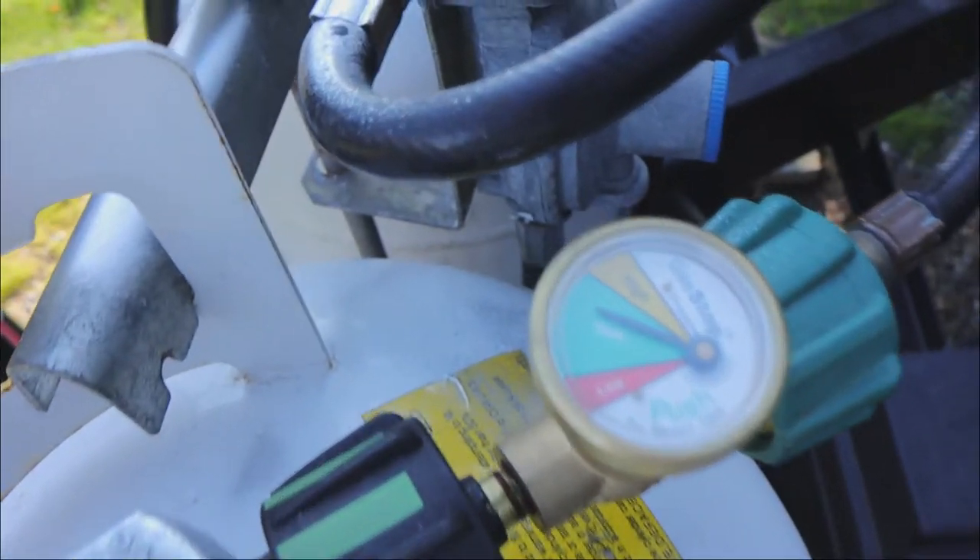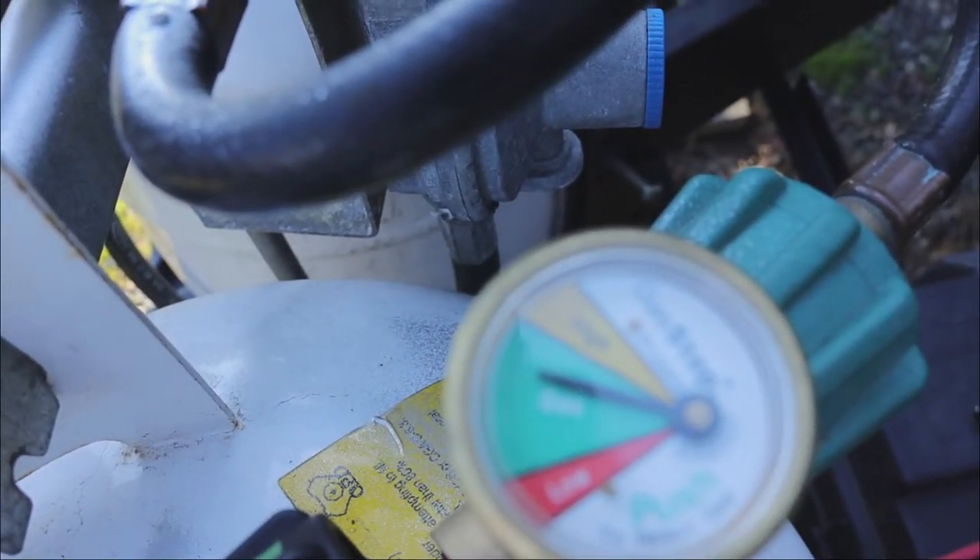You can check back in a few minutes, but if you have a slow leak, you'll start seeing that needle drop pretty rapidly — that's how you know. It's a really good idea to make this part of your pre-trip routine. It doesn't take any time at all. Bleed the line by starting your oven or stove, turn everything off, then watch that needle. We don't have a slow leak, and we also have the peace of mind with Gas Stop that if we have a rapid leak, things will shut down real quick.